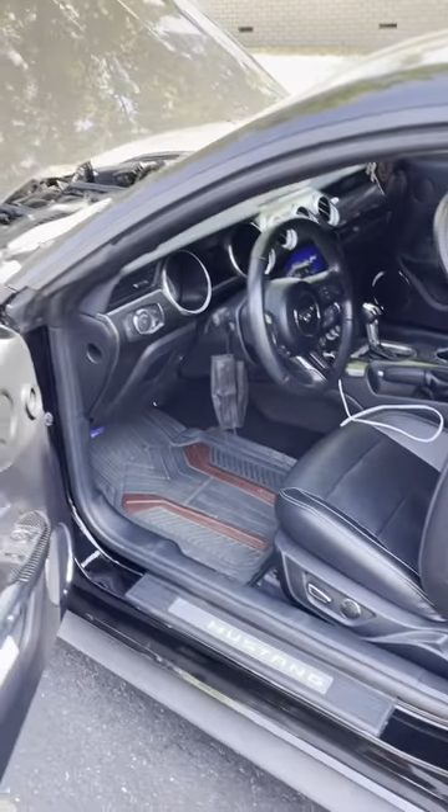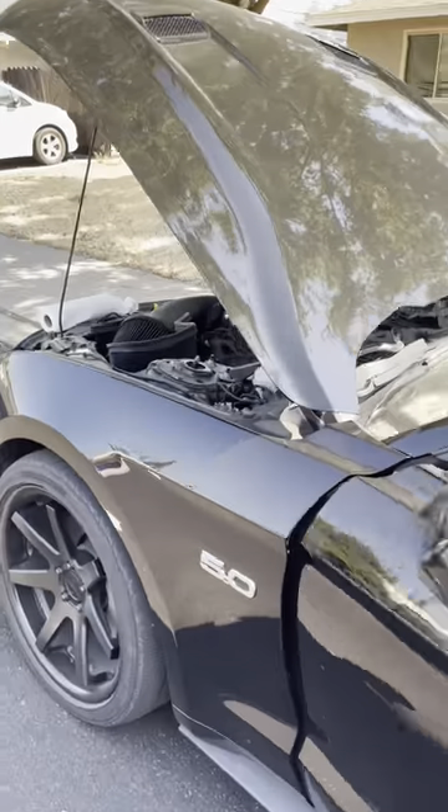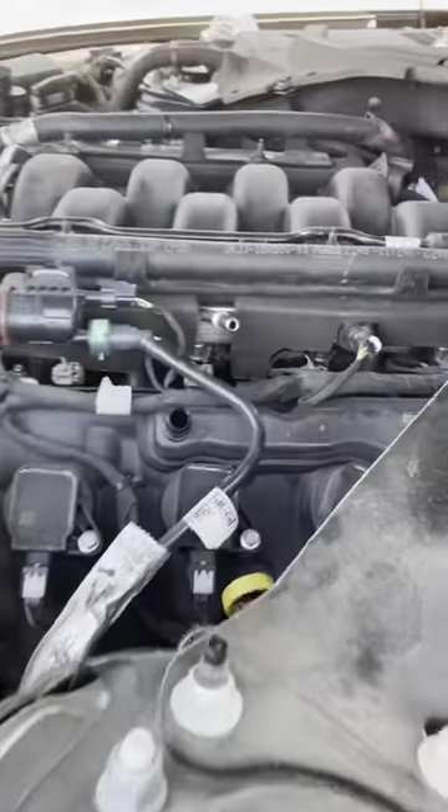Go in your car and lift up the back seat. You're going to pull out the fuel pump connector, pull out the red tab first, then disconnect it. Go start the car up a few times and let it die a few times so the gas doesn't leak - that's why it's not leaking anything.